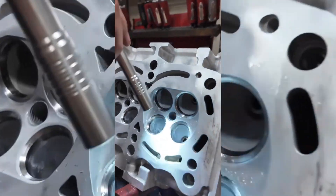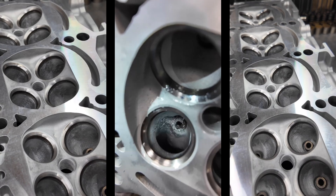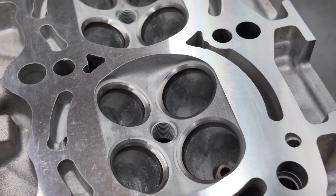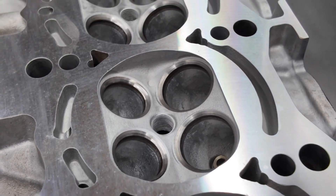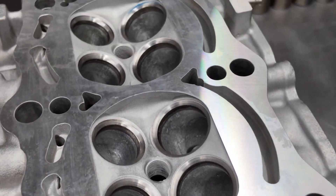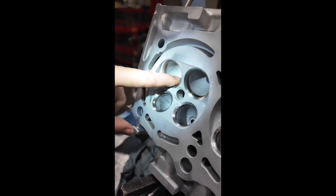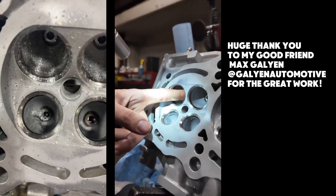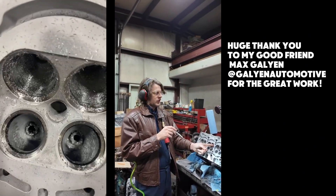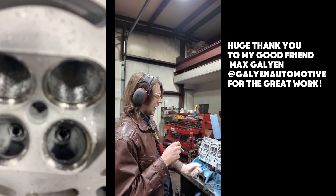Come in close — this light might be blowing out the shot — but we've got some serious flow improvement. There are no straights anymore; it's all just one nice even curve. We're good to go on those. Next we're going to do the bowl section of the intake. There's not a whole lot of work there — on the inside of each port there's a decent-sized lip, but that'll be a quick burr down, then flip the head over and do the rest.